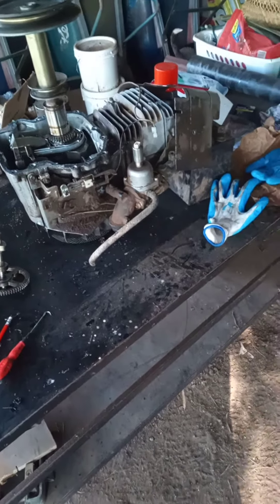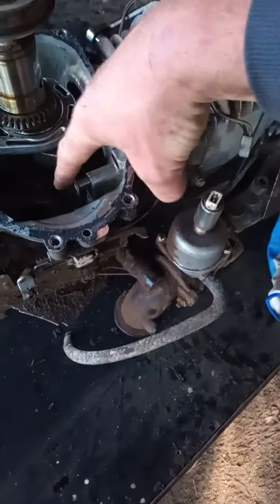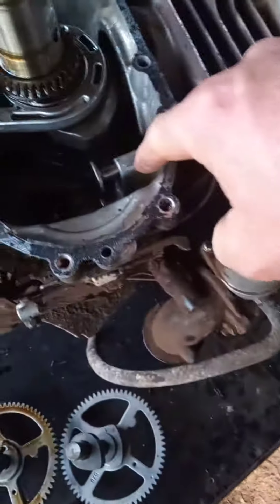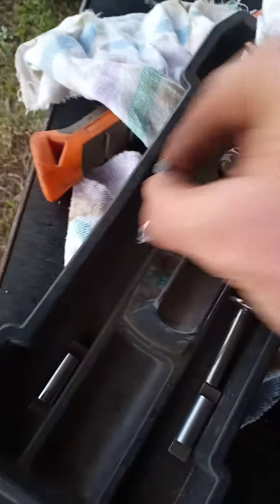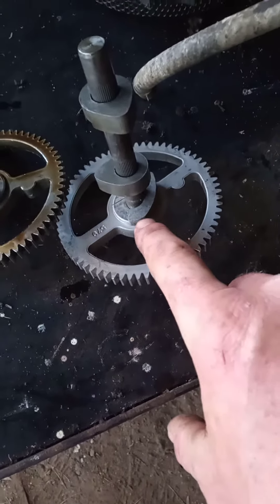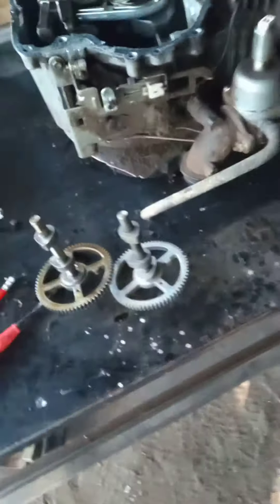Purely through common sense I got to the key point. Where you've got the rocker valves for the inlet and outlet, there's a camshaft. I went looking through the engine and the spring was over here, the other part was over here — it was off. That is what decompresses the motor so it can kick over. So if you've actually got too much compression and it stops when it tries to kick over — it's the camshaft decompressor.